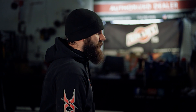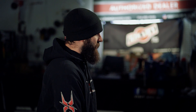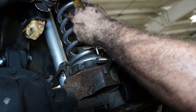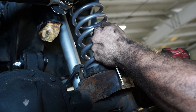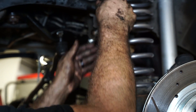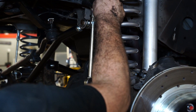The front end is 99% done. We're going to install the sway bar end link disconnects. They will have a crush sleeve that goes in between where the old sway bar end link used to mount and the new pin — make sure that's installed properly as laid out in the instructions. Slide that pin through, put your nut on, put a screwdriver in the end of it and tighten it down. Once done, put your sway bar end links on the sway bar and make sure they're adjusted to the proper length.